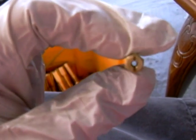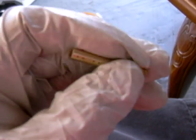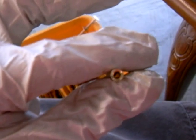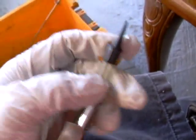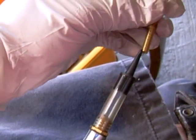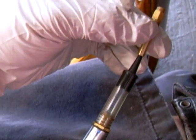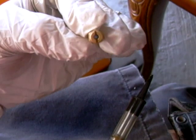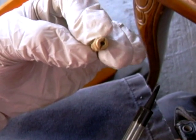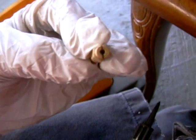I'm going to clean my main jet here. As you can see, there's an orifice — it was pretty gummed up and it's pretty hard to clean these things. If you can't get the sewing thread through there to clean it, you could always use compressed air. I'm basically using that tip to put my jet in and spray out the gunk. Believe it or not, it does a really good job — compressed air to get this gunk out. I'm amazed; the orifice did get a lot bigger. That's how I got my main jet to clear.